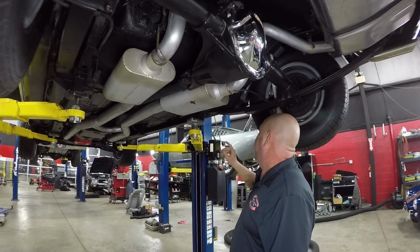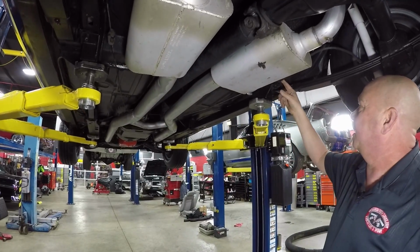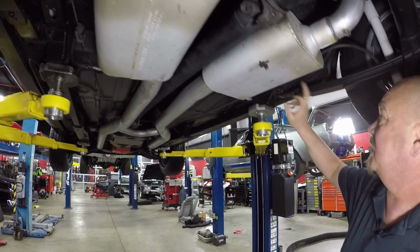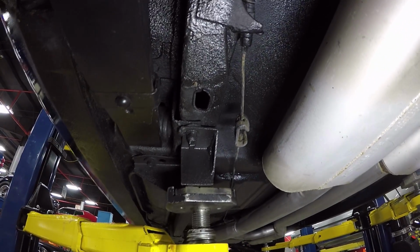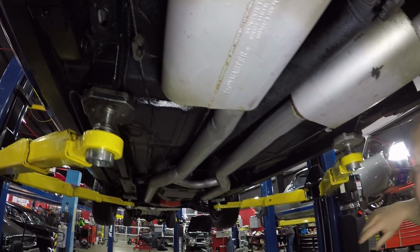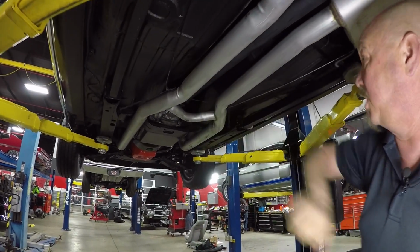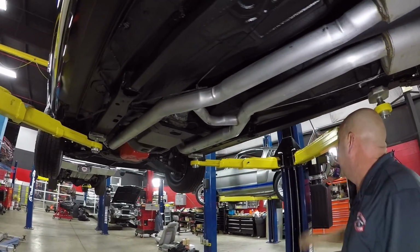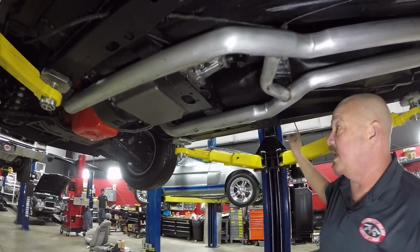On a Camaro, the first thing I look at is I look at the frame right here, where these two pieces of metal are welded together. You can see this frame's in good shape. It does look like the gas line was replaced at one time. I see some bright, shiny metal there. Floorboards look original to the car and they're in beautiful shape. The pinch weld's in good shape. Bottom side of the rocker's nice and clean.